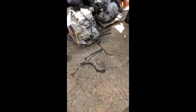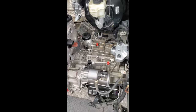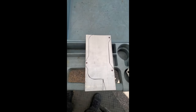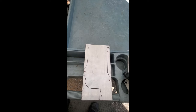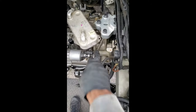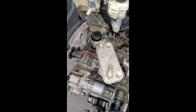I even grabbed the hoses off of this automatic transmission and tested whether they would slide down into the slot — they were a little too large. I've dashed out my template, leaving a little extra provision on the back side for the ground strap. I'll slice this on an angle so I'll have extra room for grounding straps right there that connect the transmission and ground the engine to the electronics. If this is bolted into position, I'll have an extra slot of aluminum sticking out to mount a ground strap.